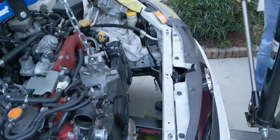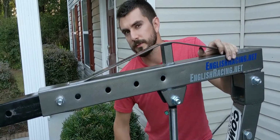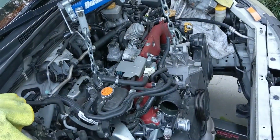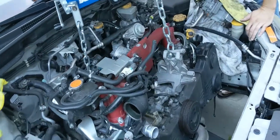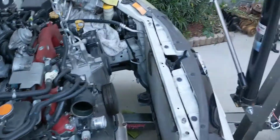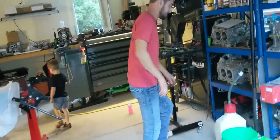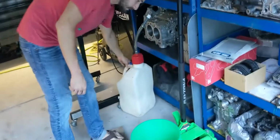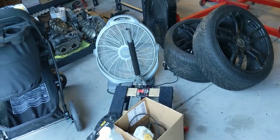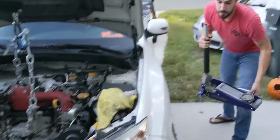Well, you forgot the jack under the trans, so there's that. We're not there yet. We haven't looked at the engine yet. They usually put a jack under the trans. Yep, that helps to break the bell housing loose, right? Well, and when the engine rocks forward, and when you pull the engine off, you don't want the trans to just eat the cross member. Oh yeah, that's what my little baby jack's good for. You want to use baby jack? It's right there. No, I usually go in between the legs right here, but that's usually something I do first.